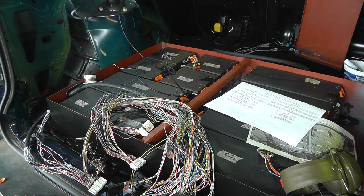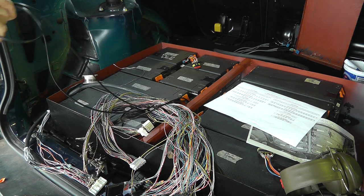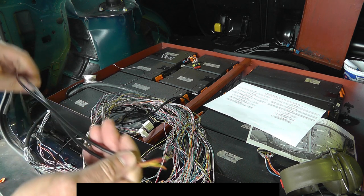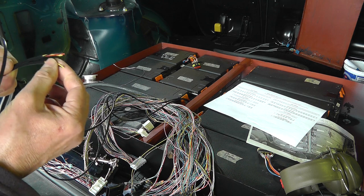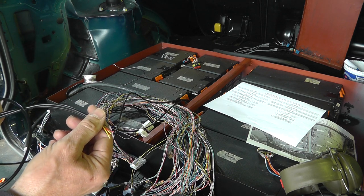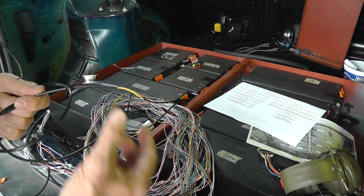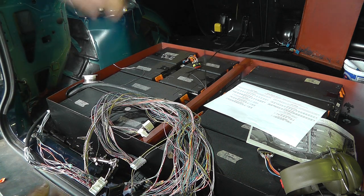As you can see, I've also got these wires coming out of the lower battery box below this. I'm going to have another couple coming out of the far one. These are temperature sensor wires. I can't remember the model number, but they're Dallas something temperature sensors. And the way they work is you can have 4, 5, 6, 10, whatever number you want, all connected in parallel. These all go back to an ESP32 or an Arduino, and with a little bit of programming you can pick up the temperatures in all of the temperature sensors. So these are pretty handy. So we'll get the other cable and we'll get started.